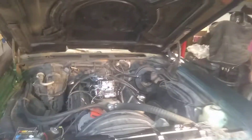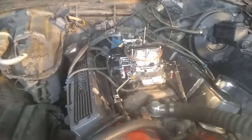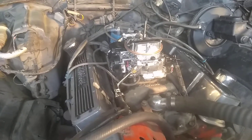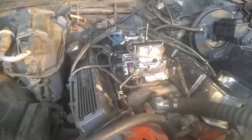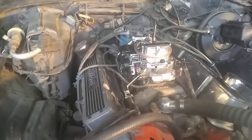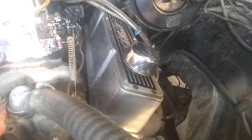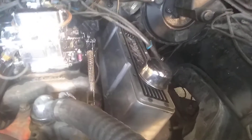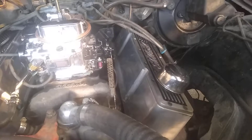Okay, so here we are. With this car, he was explaining to me that with the new rear end gear of 4.11, it's going to be running a lot harder in higher RPMs all through the entire cruising and driving range, which is true. So we got a little breather back there on the air cleaner and we also got this breather here. He said that because we do not have a PCV hooked up, it's going to push oil out through one of these breathers just due to the atmospheric pressure.